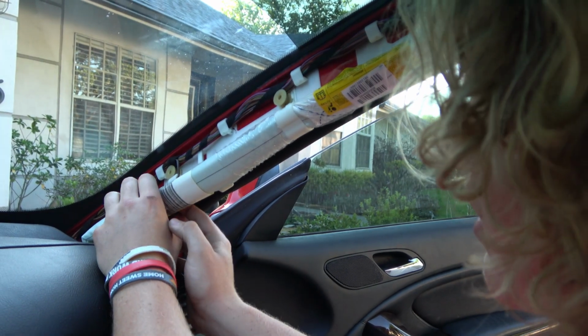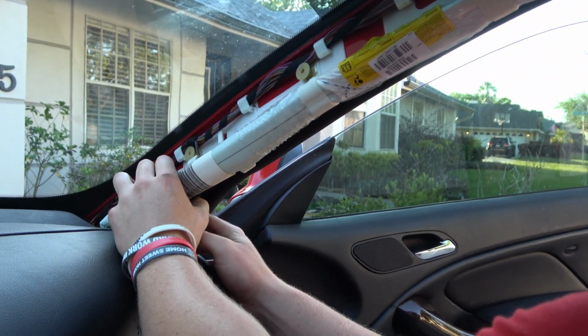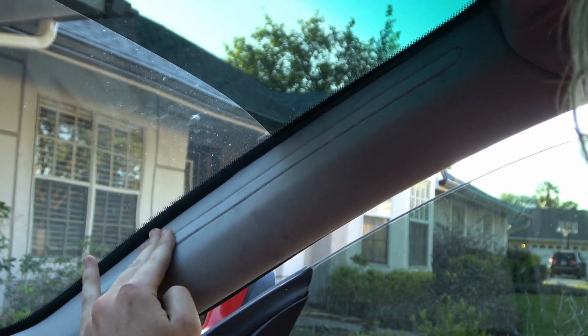Disconnect the battery again and tuck the automatic window sensor wire behind the airbag. Carefully put the A-pillar trim piece back in, being mindful of the plastic tabs. Wind in the Torx screws and replace the center trim piece.